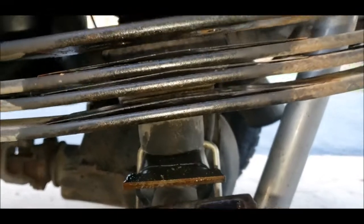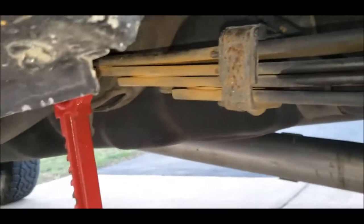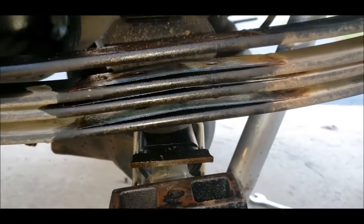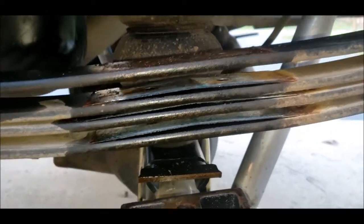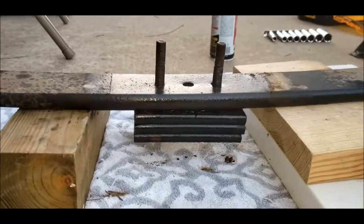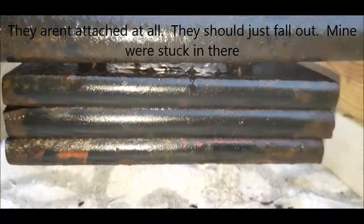All right, so this is what the spring packs look like with no clamps on them, besides the factory clamps there. Definitely don't mess with any of that. Once you start pulling the springs out, you've got to worry about the springs having a lot of built up tension. But just in here, really the only thing that happens when I pop this bolt off is it makes a pop and it moves about a quarter of an inch, but nothing too scary. Then you get the leaf pack out, or at least the lift part of it and the overload. Anyway, so you see there's two bolts.